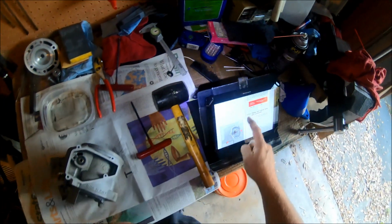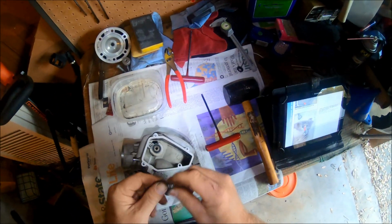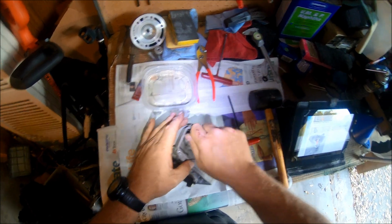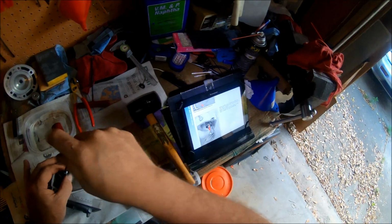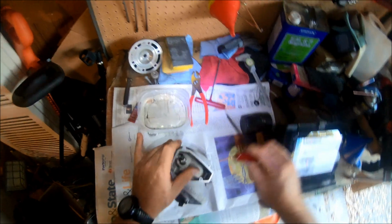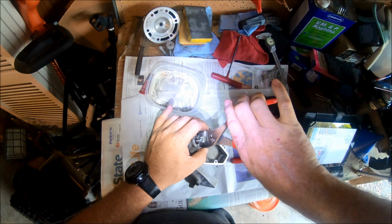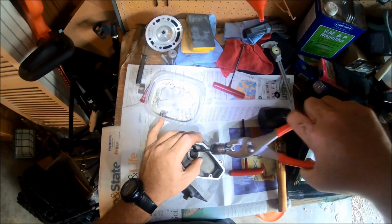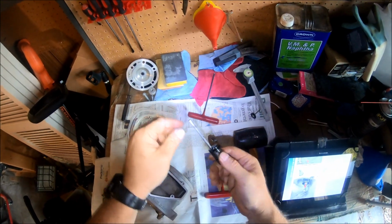And then it also says to use a 5mm bolt to pull these bearings out, which luckily enough this guy right here is an M5 screw. That's what that is. Not 5mm, but M5. So screw that in there and then slowly, gingerly pull out. Oh, the bar came with it. So there's part of your power valve. There's the bar.